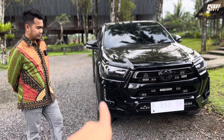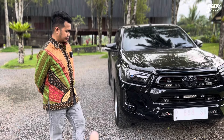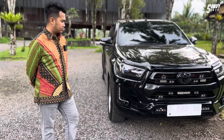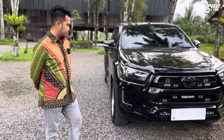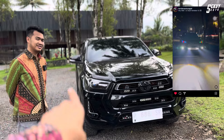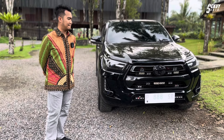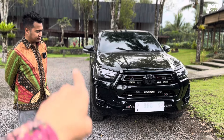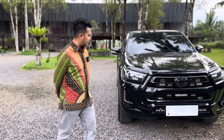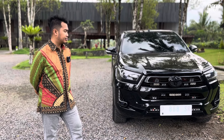The lower cover and eyebrow covers are imported since custom-making them locally is difficult. The covers were repurchased and then the eyebrows were custom-fitted. The left and right eyebrows can be set differently and controlled via an app called LED Lamp. There are 3 modules in total. For demon lights, only the headlamp has them — not the foglamp, to avoid condensation issues since the housing is waterproof.